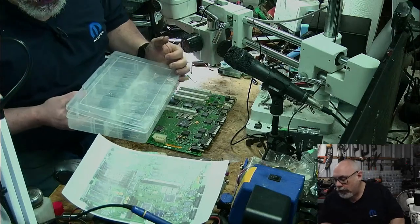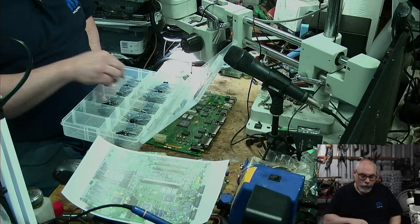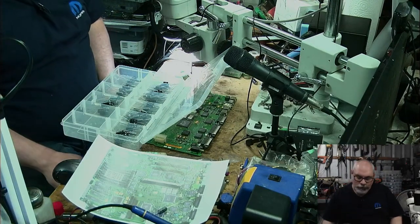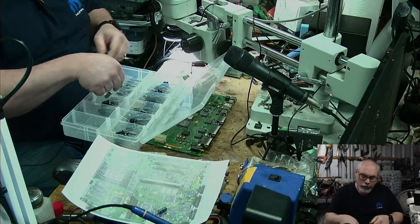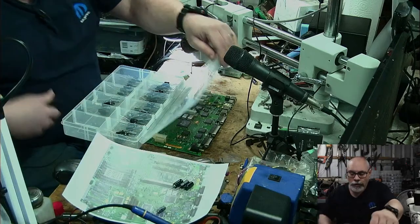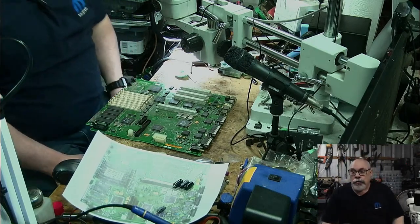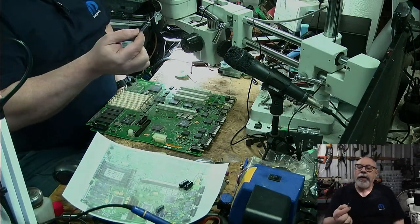And I am going to need one 220 microfarad 16 volt. But anyone who's watched my streams before knows that I upgrade them and put in a 25 volt instead of 16 volt. And then 470s, 16 volts. We're going to do the same with that. 470, 25 volts. So we're replacing the 16 volt ones with 25 volt ones. It's worth mentioning that you can go up in voltage, but do not go down. And don't alter the capacitance rating. So capacitors have two ratings. They have the rating of their capacitance, and they have the rating of their voltage.